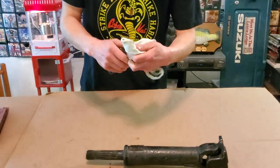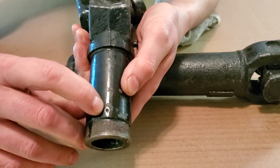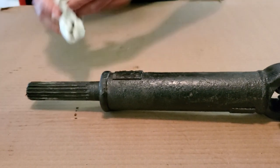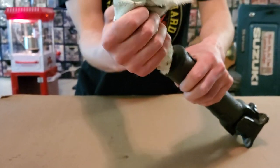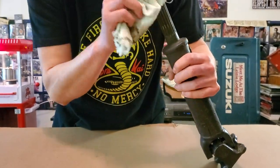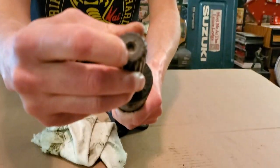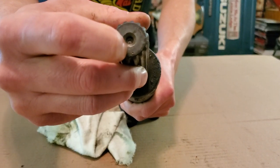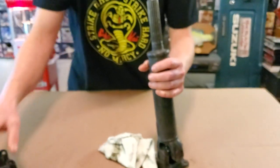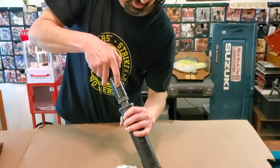We'll get Jennifer to zoom in. Here's the slip yoke — you can see this dot here. That's the dot on your slip yoke. You want to take a rag and get all that greasy, nasty stuff off the tip of your splines. Now you got a dot right there — this one can be tough to see. That's the dot. So you're going to take this dot, line it up with that dot, fold her over, and slide her on in.